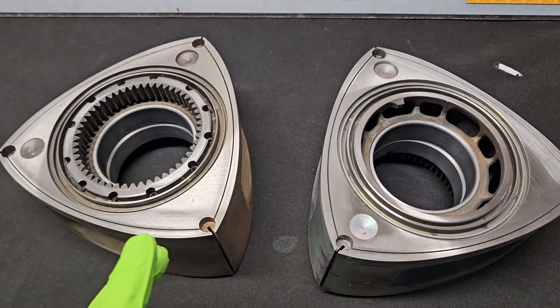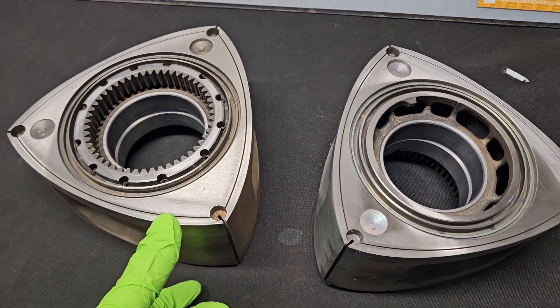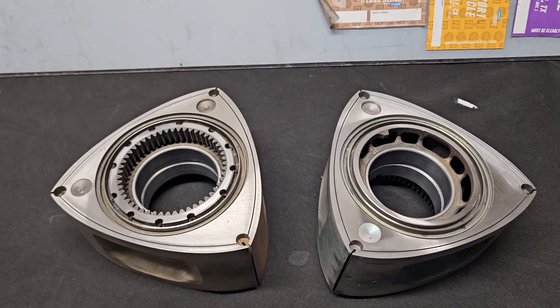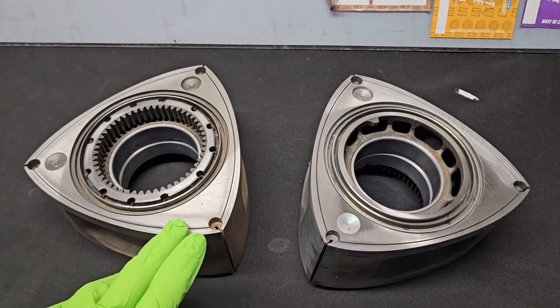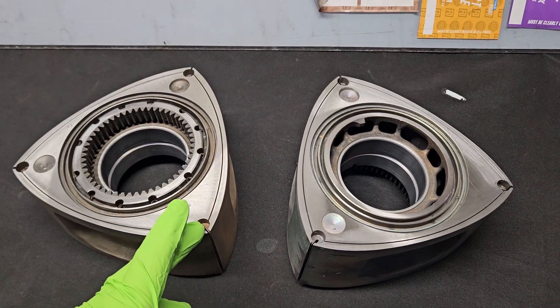What we're talking about here is going to be balancing and also side clearancing and matching up the widths of the rotors. RX-7 and RX-8 rotors have some minor dimensional differences, and as you start to spin rotaries faster, more eccentric shaft deflection happens.